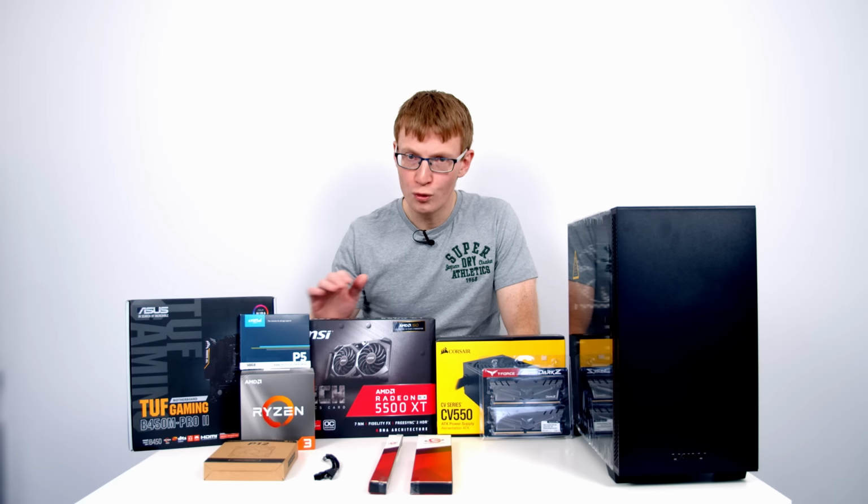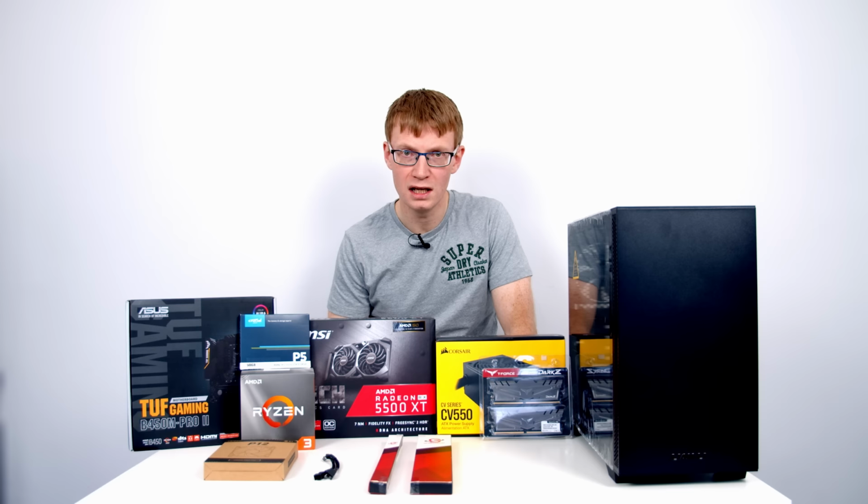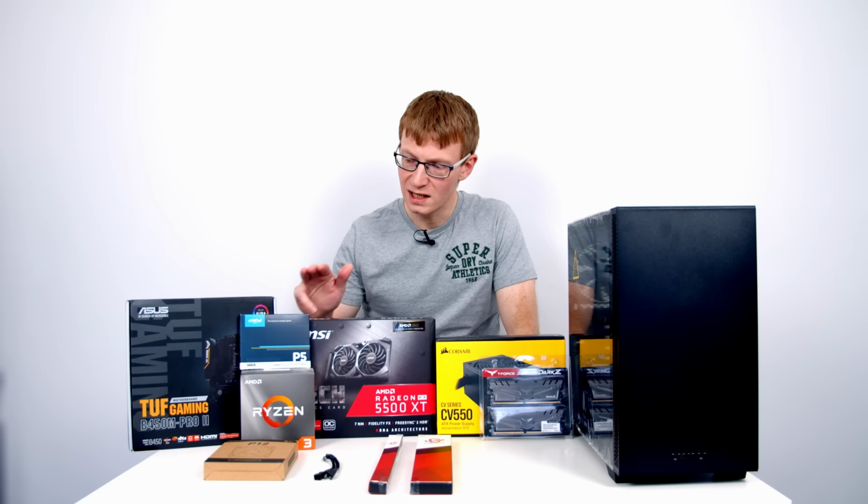An important word of caution: when you're looking for these drives, be careful, because M.2 SSD does not necessarily mean NVMe. There's also SATA versions of the M.2 drives, which are going to perform at a similar speed to a standard 2.5-inch SATA drive. So if you are going to look for alternatives, and I'll put a link to some alternatives in the description, it's the NVMe drive that you want to get the best performance, and it's only a few pounds extra than a SATA drive.